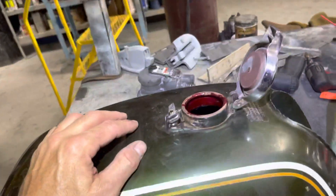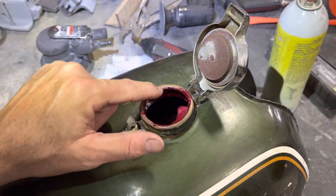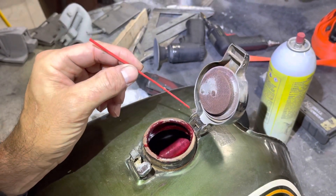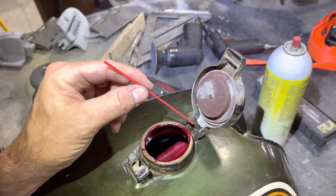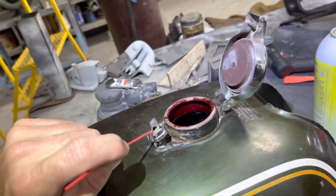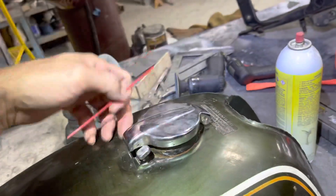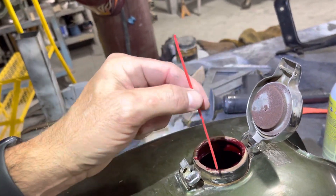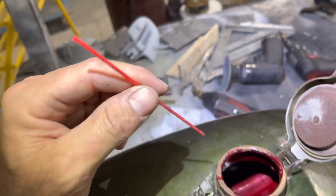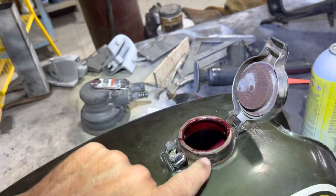On the gas tank itself, there's a lot of detail in this area. I'm going to use this little red spray nozzle to illustrate. This pin right here — I just called the shop that sent me this and asked permission to drive this pin out, along with this other pin, and he gave me permission. If not, I'd have to tape this up and it wouldn't be a very clean or thorough blasting job. So I'll put an expanding plumber's plug in here, expand it out, so I'll be able to blast this rim really cleanly.